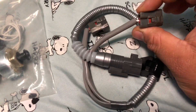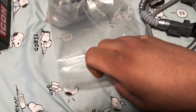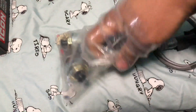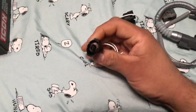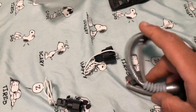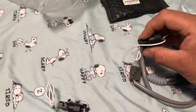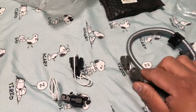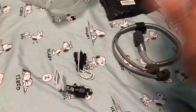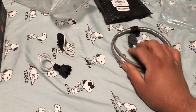Basically what we're going to do is cut these ends right here and splice in the new GM connection. Make sure you solder this, guys — do not just twist and tie. This is really really important. You don't want to just twist and tie because it sits underneath the intake manifold, and having to take that off every time to service this is a pain in the ass. I actually don't feel like doing this, but I'm tired of getting the check engine light for the knock sensor.